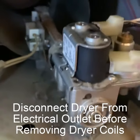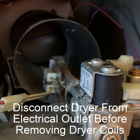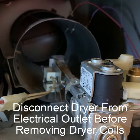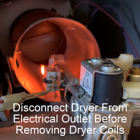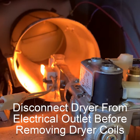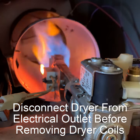I'm going to screw that down in a minute, but what I want to show you is what happens when you turn your dryer on. You see the element heating up? Gas should fire up here pretty soon. There we go — gas wasn't firing at all before.